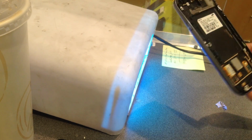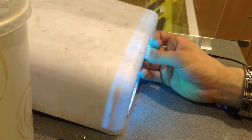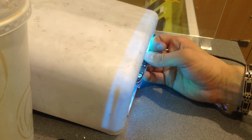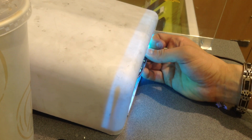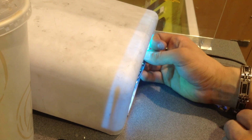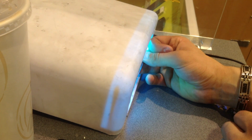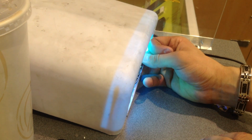Next, you want to cure the back side because that's the most important part. Curing the back is very important because of the adhesive that gets underneath the display. Curing the back helps it, and the adhesive that seeps to the back cures in place, and you don't have to worry about it. And it's easier to get off too. So, yeah.